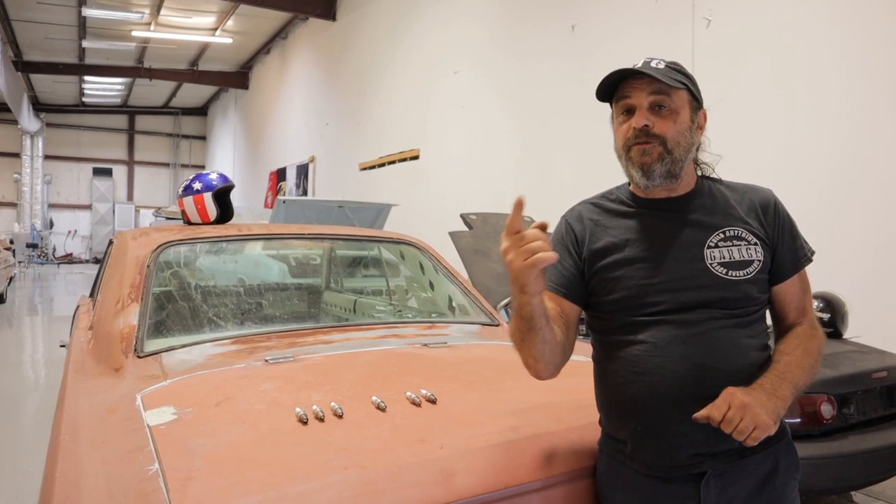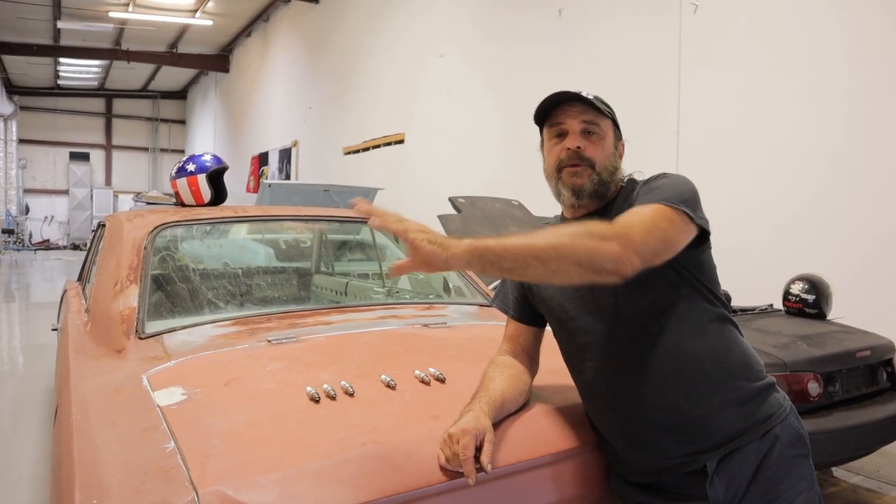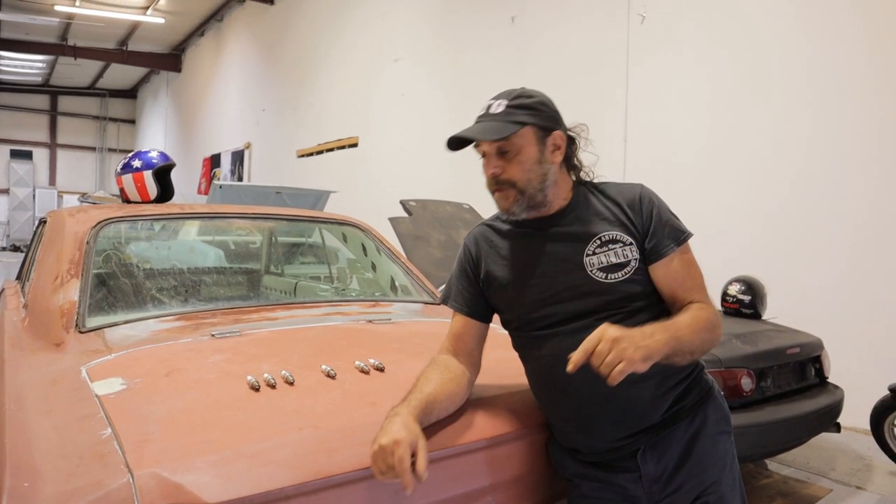The car's back together again and running. I know it's going to hurt itself, but I want one representative run — I want to take it to the track and get a good plug read. So we headed out. We pitted at the extreme end, closest to the shutoff area. Warmed the car up, then installed our run plugs — virgin plugs, brand new out of the box. And what I'm about to show you is why, when you do a plug read, you cannot use a used spark plug. Because we followed the procedure to a T, we got excellent information.